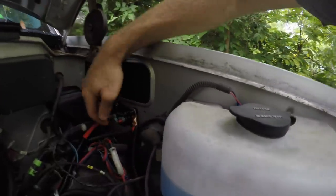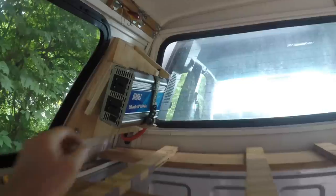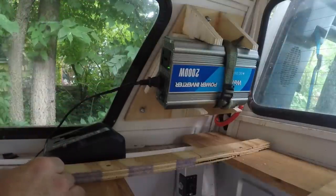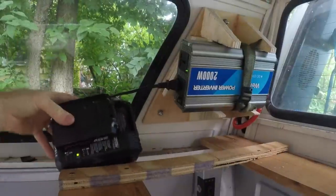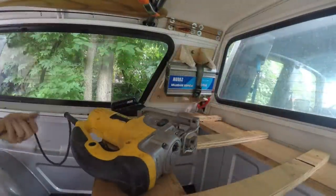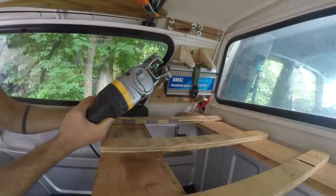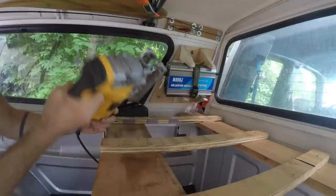At that point it was time to test it out. I flipped my breaker and the inverter in the back should be live — I switched it and it came on no problem. It's got a fan to keep it cool. The first thing I did was plug in a battery charger; I was really hoping to be able to charge batteries in the back of this truck and no problem — this is with the truck not running. In some situations you might need to fire up the truck so you don't kill your battery, but since I have two batteries I'm okay. The next thing I did was plug in my saw. I want to be able to run basic tools out of this setup, and just like the charger, no problem — plenty of power and it seems to be working really well.